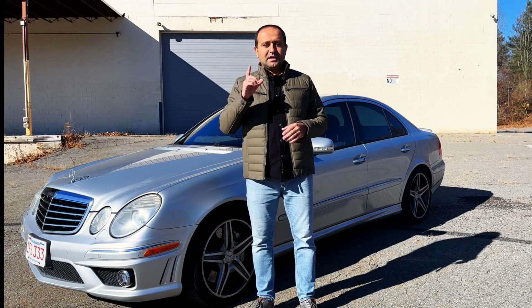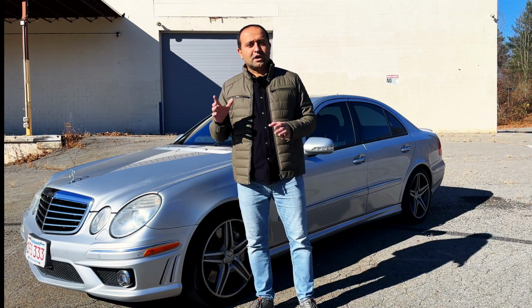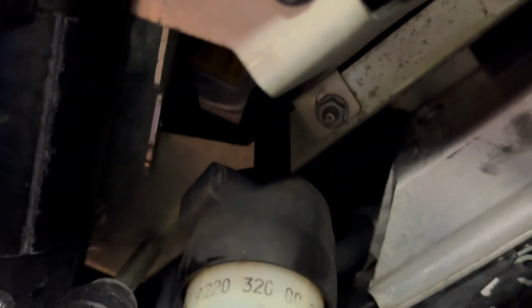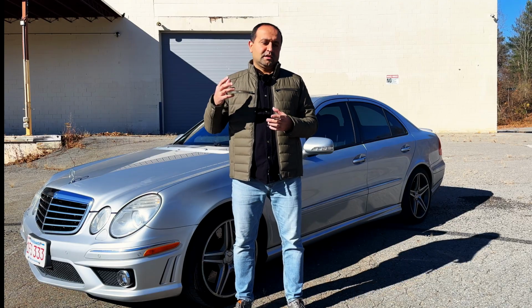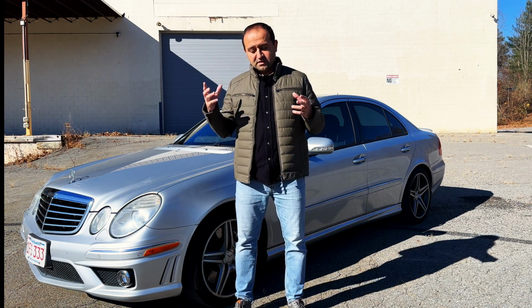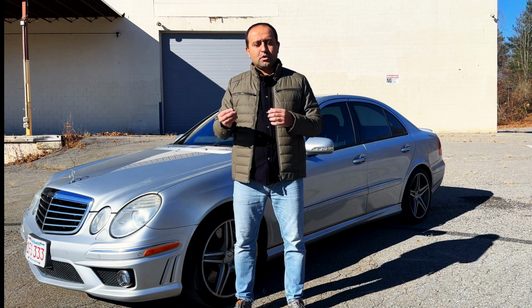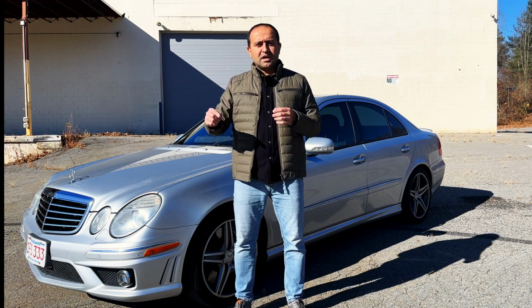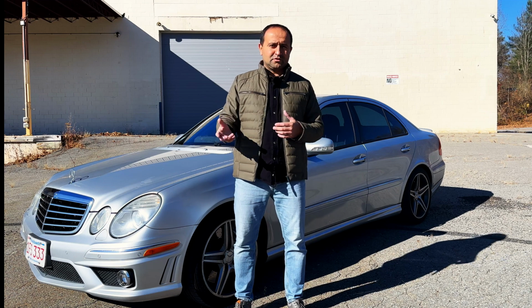Next tip, the Airmatic filter. I made a video on how to replace the Airmatic filter. You can find that link in the description box down below. It's important to replace the Airmatic filter, especially if you had a leak in the system and had to replace the springs, because you don't want any dust or dirt particles flying through the lines into the system, getting into the valve, getting into the compressor, etc.